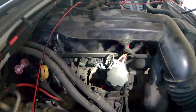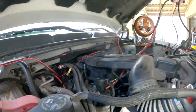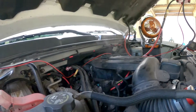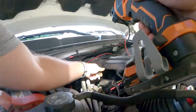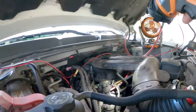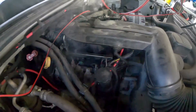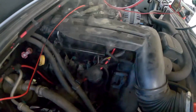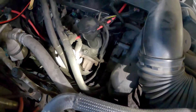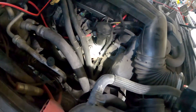What I'll do is seal that hole really quick and show you some other leaks I found. I plugged it with a little tube just to kind of plug the hole off - we put a little seal there. But as you can see, there's smoke coming out from other places as well: the oil filler neck gasket and the intake manifold gasket unfortunately.